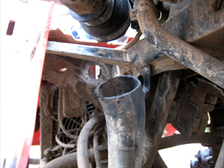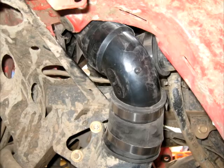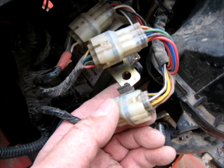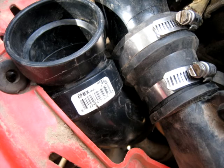The pipe in the bottom of this picture is the inlet for the CVT cooling. A two-inch straight rubber coupling will fit there perfectly, and for this pipe work we are going to use two-inch pipe. You'll need to move these wiring connections out of the way and bend up this tab so that the pipe work can fit through.